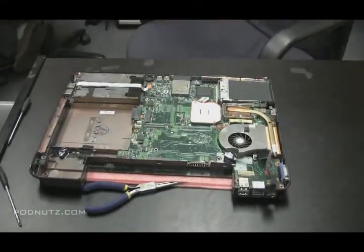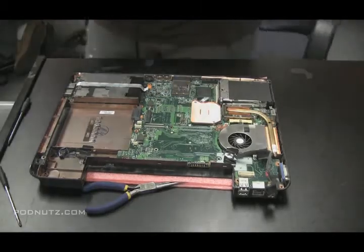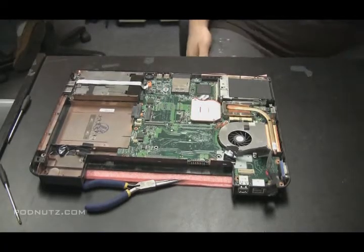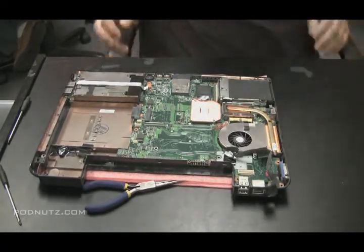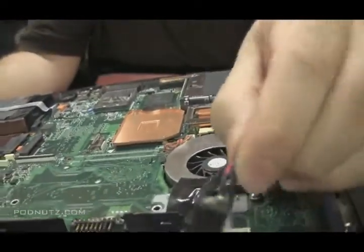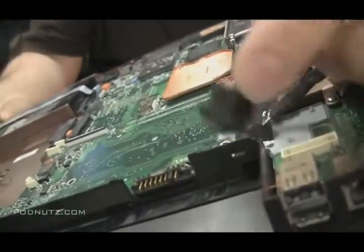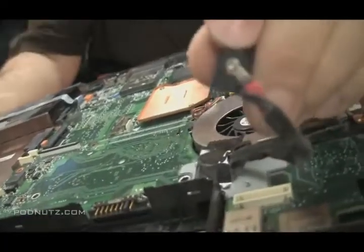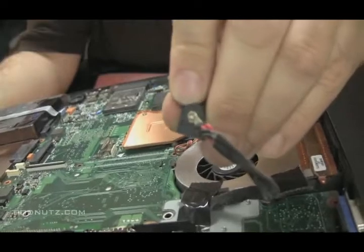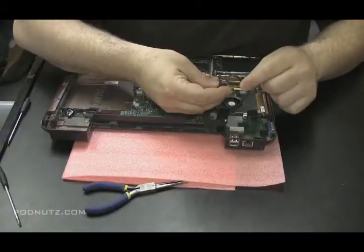Going to take the soldering iron now, get it heated up. This way, when I'm ready to solder on there, everything will be hot. Okay, there's the jack and the tip. And it's not really in focus, but the tip goes all the way through to the end, to the back of the jack. And you can't really see it, but I'm going to basically take some solder, put it on right in the middle there, that circle in the middle, and solder it to another point of contact that I know is going into the motherboard.